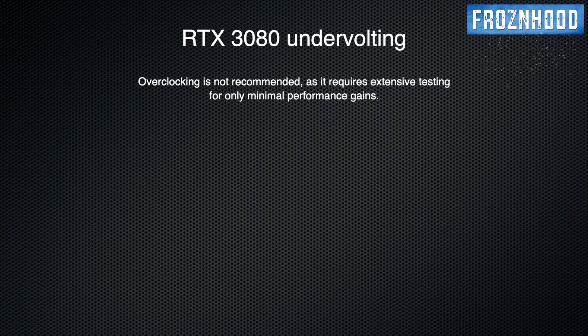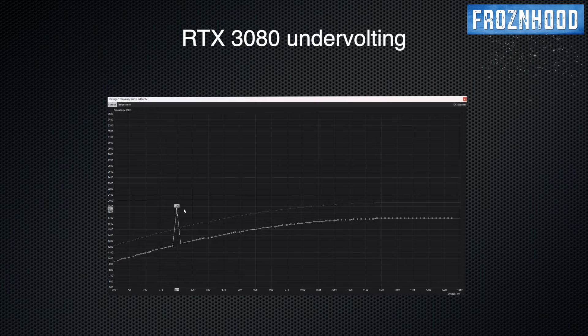In the results later, you will also see an example with 2000 MHz and 937 mV — it is basically an overclock, but with much lower voltage than the default. I'm mainly showing this as another example of how the RTX 3080 can operate more efficiently even with additional overclocking. I don't recommend overclocking; I don't think it is worth it or even necessary — it is just an example. Something I also want to mention: some people set multiple manual voltage settings for different frequencies — for example, one voltage for 1800 MHz, another for 1850 MHz, 1900 MHz, and so on. In my opinion, this is a waste of time. It requires a lot more time for testing because if the system is not stable, you need to figure out which step is failing. And in the end, you don't get better results. I don't recommend this approach.